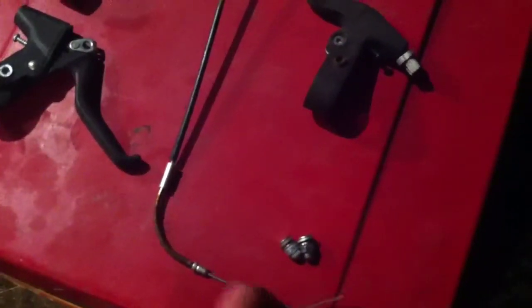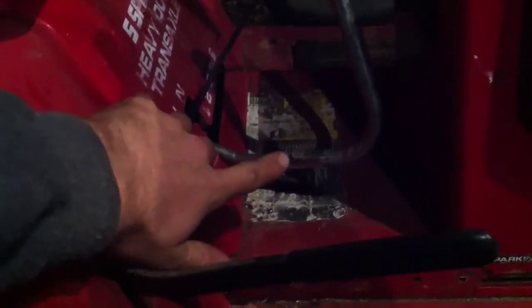I've got one of these spring-return levers trimmed up for my foot pedal, I've got my cable, and I'm going to try to use one of these 90-degree fittings to see how it works. I've got two little brake cable holders that originally went where the brake clamps are on the back tire - those are what I'll use on the cable to space it out and use on the governor.